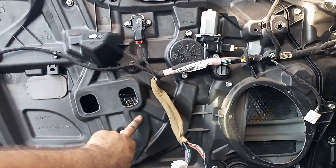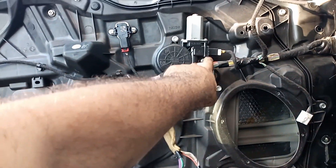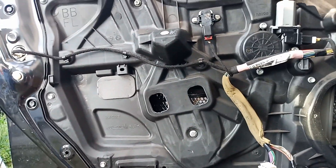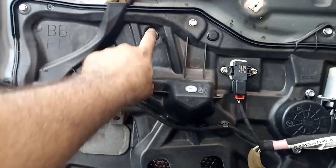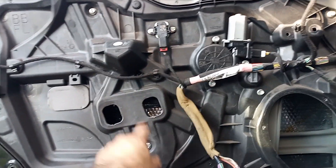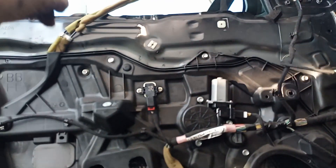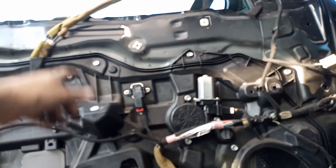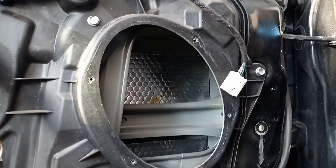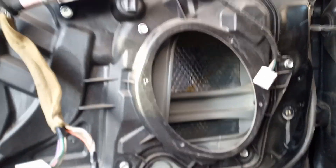I just put everything back - one through eleven bolts for this cover. You have to take these three off to separate the window regulator, and this nut here is the actual window regulator. In order to get this plastic off you have to take those off, so when you do that make sure you catch the window because that's when it's gonna come down. Push it up, hold it or grab somebody to hold it - it just takes some finessing.